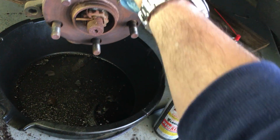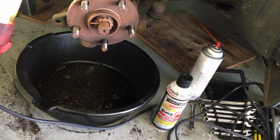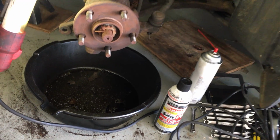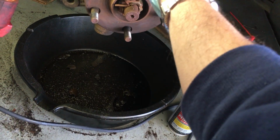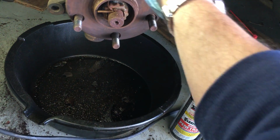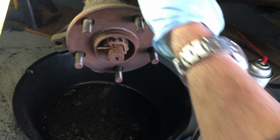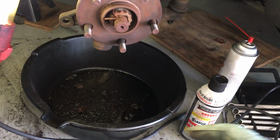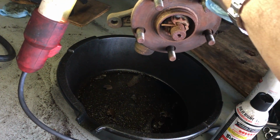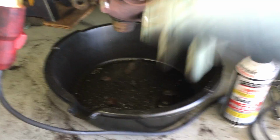The second thing I want to clarify is there seemed to be very little information on how to replace that dust shield. This is a 94 Camry, and you can see here these bolts. There's nothing left of this dust shield here. There's actually 4 on this Camry. And these bolts are really hard to get out. First of all, they're rusted really badly, and they're sitting behind the hub here.